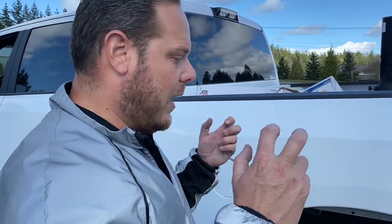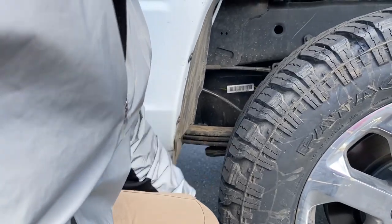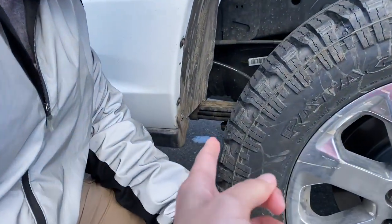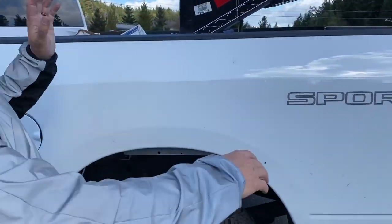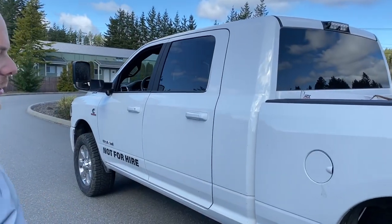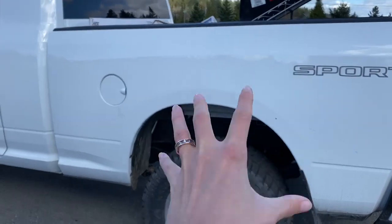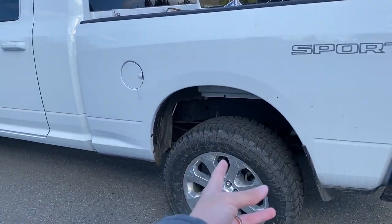With the bags you want to get back up to your normal ride height, like what the factory set, which actually gets you off this helper spring — this load-leveling spring that you compress into when the rear starts to sit down. We've always been really deep into that. This is nice — we're back up. That should put more weight back on the trailer axles and level everything out, distributing the weight more evenly across the front and rear axles rather than concentrating it all right on the rear axle.